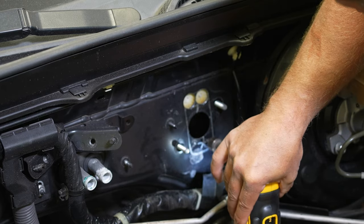All right, lastly, we're gonna install the feed line, which runs up to the clutch master cylinder. So we're gonna thread this fitting on to dash three. Now, since this fitting spins in here, if you try to turn that without holding that other fitting, it's just gonna spin on you. So you're gonna wanna hold that when you get this tight. Get it snug and go about an eighth to a quarter. And you're good to go. So this actually pivots around.